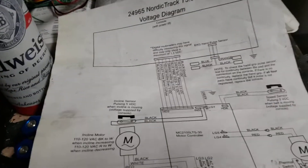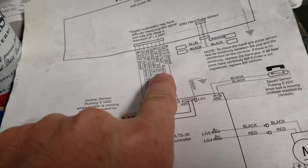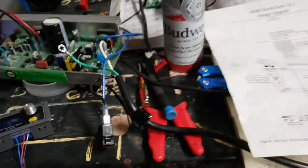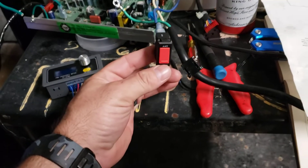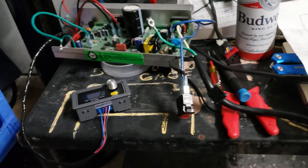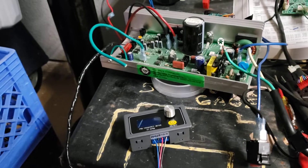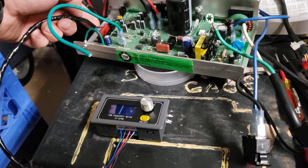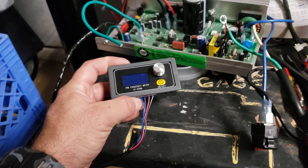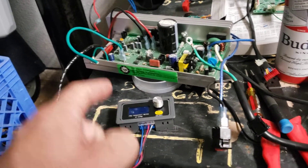You don't need this one anymore back here. And you keep your black and white ground, your blue PWM, and your red 8 to 12 volt DC. This normal wiring here has got your on and off reset switch that would be located at the bottom of the treadmill. You hook all this up normal as it would be if it were on the treadmill. The only difference is you have this main board and you've done a wire delete and hooked it up to this pulse width modulator, which you can find on Amazon. I'll leave a link in the description down below. It's only like 15 bucks — not expensive at all, and it's exactly what you need.